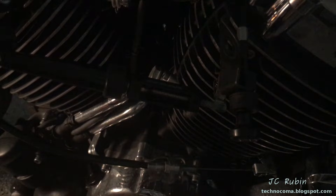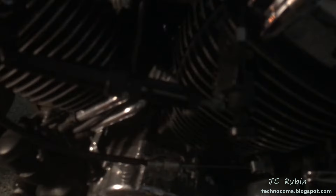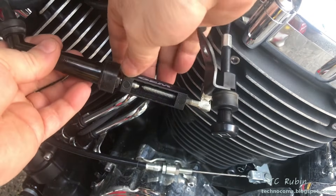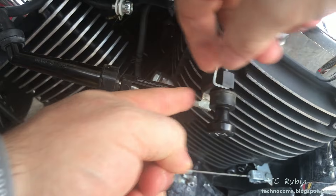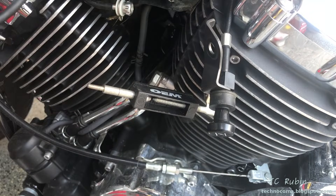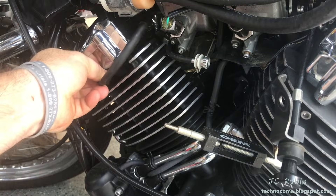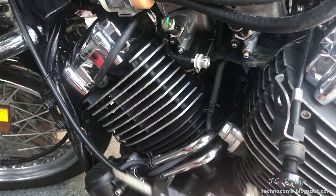We can see right there — getting closer — good ignition. Such a test can easily be repeated on the other side, and that side's good too. When finished, make sure the bike is off before removing — you don't want to get zapped. Remove from the spark plug side first before the ground, then put the cable back in and unclip the connector.